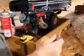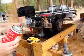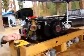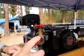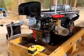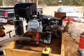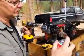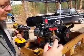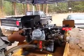What we do with that is we'll take a carb cleaner. This is where the air comes in — the intake is open right now. What we can do is reach in there and shake it up, because the carburetor cleaner is actually flammable. So then you spray a certain amount in there, and then we'll spin the engine counterclockwise to basically clean out any tar that's in there. If you've done a long run you could do that a couple of times, and if you're seeing a lot of moisture you could do it four times to make sure you've cleaned it out really well. What you're doing is washing the valve stem off and dissolving the tar and pulling it all the way through and burning it out of the system.